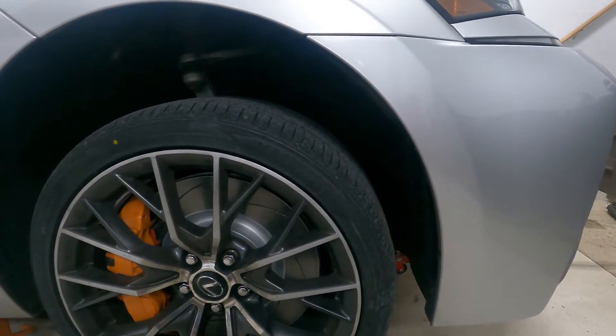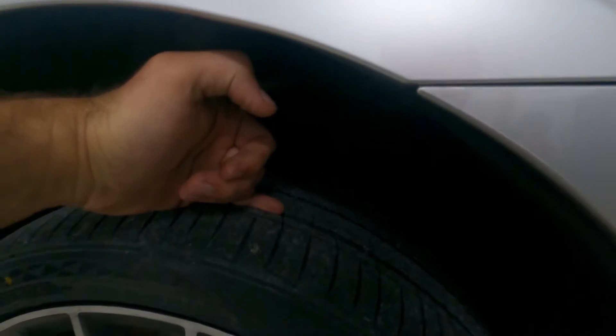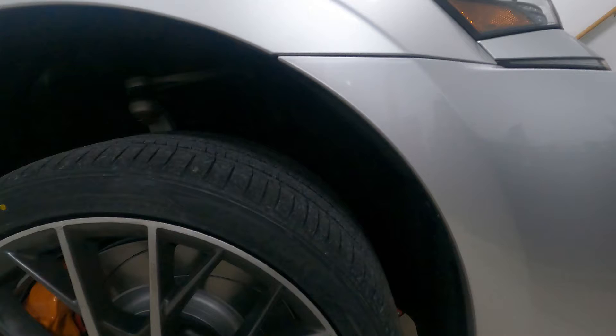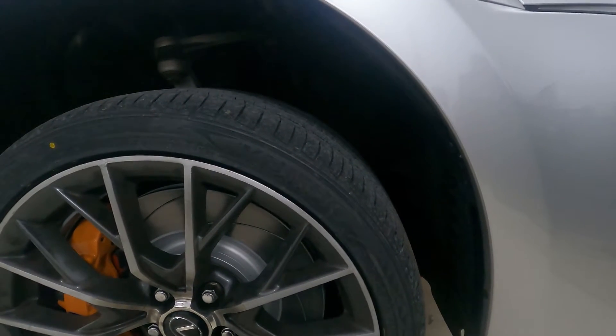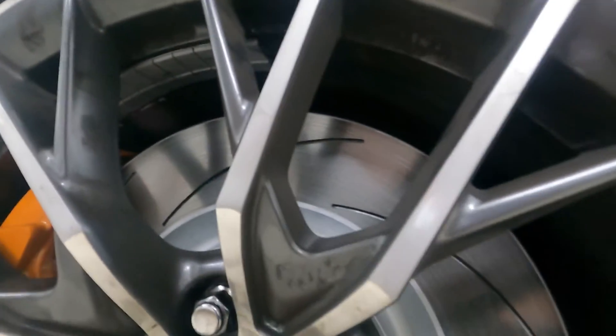Fortunately for me, I know people in the business. So I had to replace this tire — we caught a nail right in the side here. From this tread site over and from the inside tread site over, you're not supposed to repair, because that's kind of where the metal belt, the radial belt ends, and the plug won't hold, the patch won't hold, and the tire needed to be replaced. So we replaced the tire. But when we put it on the balancer, the wheel had a noticeable wobble to it and it took a ton of weight to balance. You'll see here that I had to double stack the weights on the outside of the rim, and there is also a very large amount of weight on the inside. This is close to five ounces.